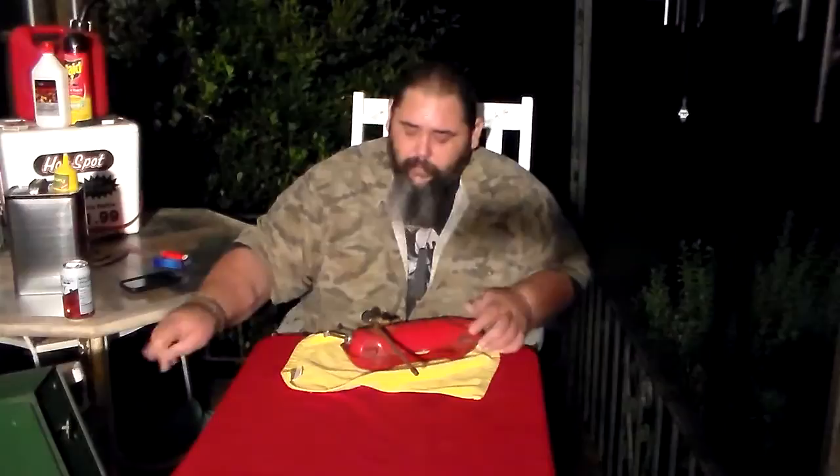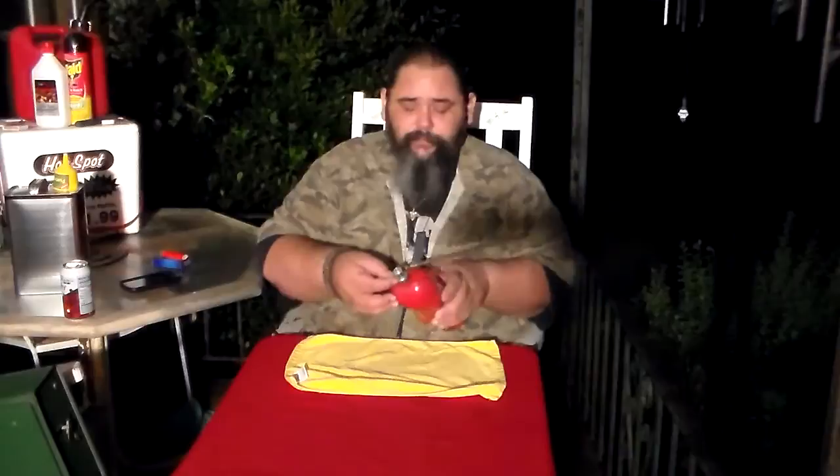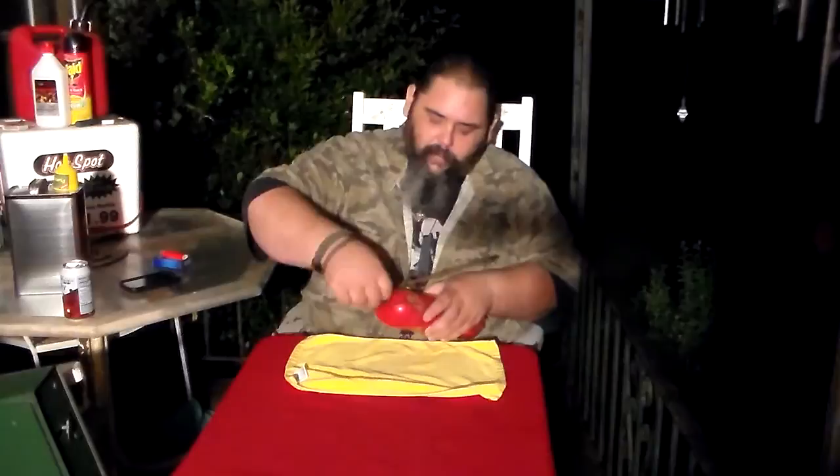The way to deal with that — there's that little vent hole. I don't know if the camera will pick that up or not. But you can see maybe there's a little bell or ring here. Just pull that pump out of the way enough, you can get a grip on that thing and pull it out on both sides. When you do that, that'll come off there, free up from the tank, and the whole thing just slides right out.